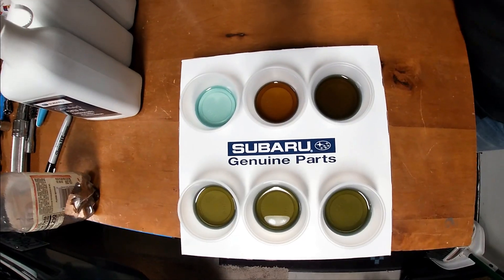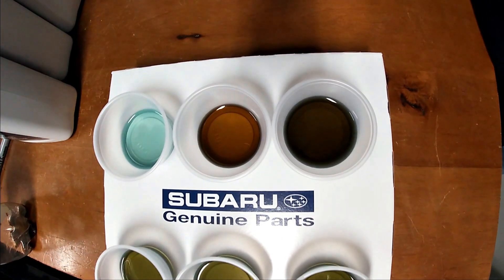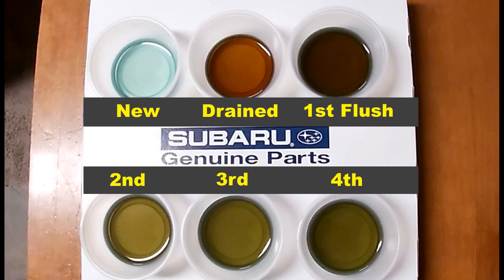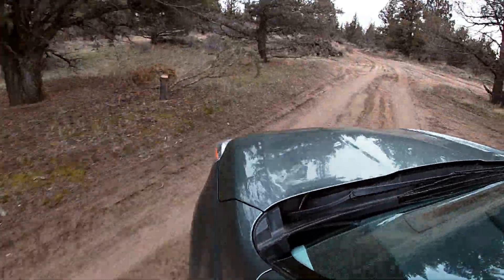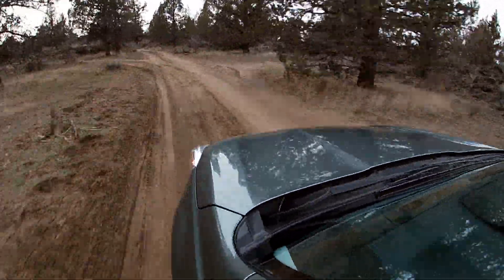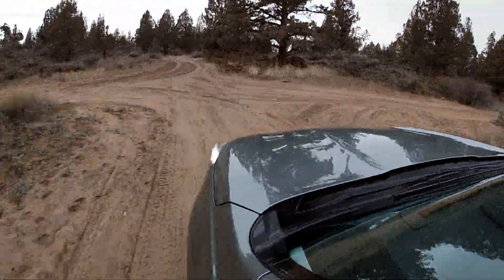Here's a quick look at the fluid samples I took during the drain and sequential flushes compared to the new fluid — you'll see that the color change became very unnoticeable. Overall I think next time I do this, which may be in about 60,000 miles, I probably would not do so many flushes. I would probably just drain the pan and do one, maybe two flushes and call it good. I hope this video helps somebody out — please hit that subscribe button below and leave any questions or comments below. Thanks guys, I'll see you next time!